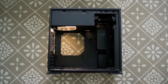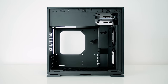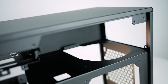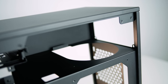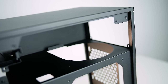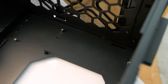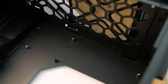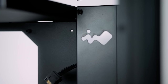As for the main chamber, it seems to have all the primary elements, like a large CPU backplate, an open frame with a plastic cable cover beside the motherboard. The power supply chamber is at the top, fully closed off, aside from having the fan openings and the small cutouts for the cables. So the power supply is an active component for interior cooling. The bottom supports dual 120mm fans, but unfortunately no cutouts are available right underneath the motherboard, which is the consequence of having the power supply chamber at the top while wanting to minimize the height.